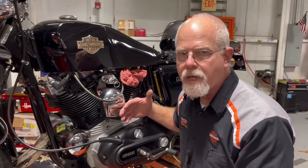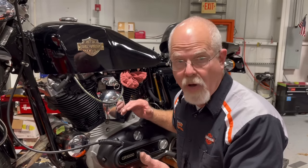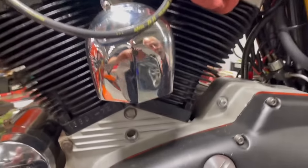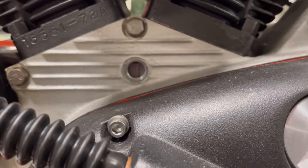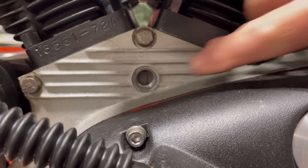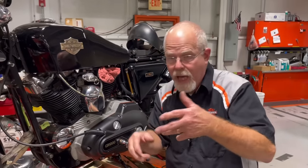What we're trying to do is get the piston in the position where the spark plug would fire. If my camera person will take a look in here — there is the timing mark. It's a line on this model. On other models it could be a double dot, sideways, or a line — Harley-Davidson played with so many different timing marks.